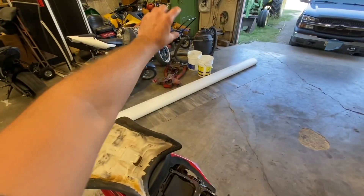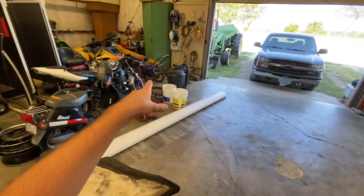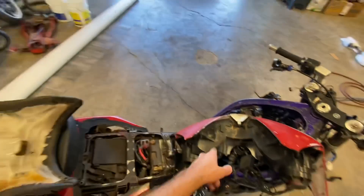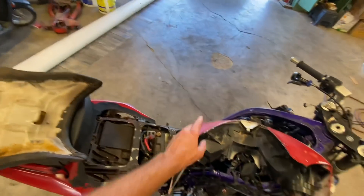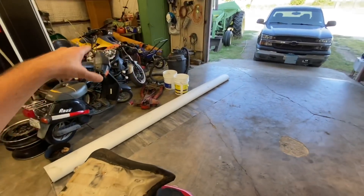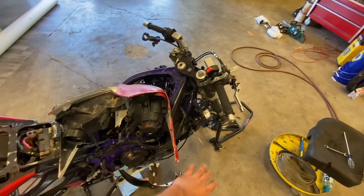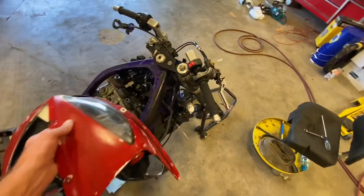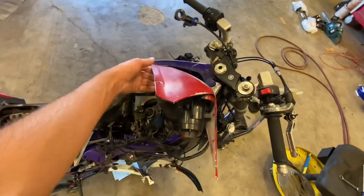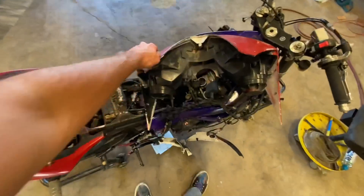It's already been cut so it should just fit over that. I think all the screws are appropriate. We have to take the headlight out of the steel stay — it's just three screws — set it up on the headlight, put the three screws on, then put it all back on the steel stay. Also, before I take apart the front end it's gonna drop down, so that's the wrong way to disassemble a bike.